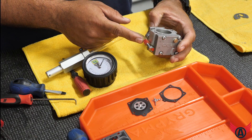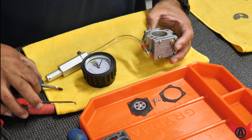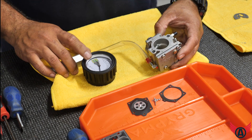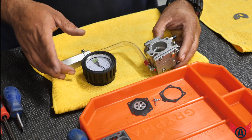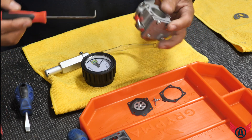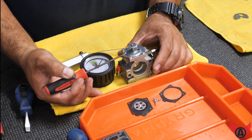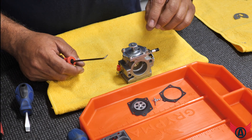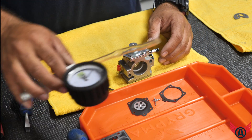I have a piece of red hose here that's a little bit smaller as my main hose is too big. You don't want any leaks anywhere — you want everything to be a good seal. Simply use this gauge, pop it two or three times, and check for the pressure that's holding on the carburetor. That's the reading recommended by the manufacturer for the pop-off pressure. To adjust that pop-off pressure, unfortunately you have to take apart the carburetor one more time, and the spring that was inside this side underneath the arm needs to be replaced. Most of the time that is not an issue. Sometimes you can stretch it a little or compress it to come up with the right pressure, and sometimes people cut the spring a little bit short — but basically that's what you do to adjust the pop-off pressure.